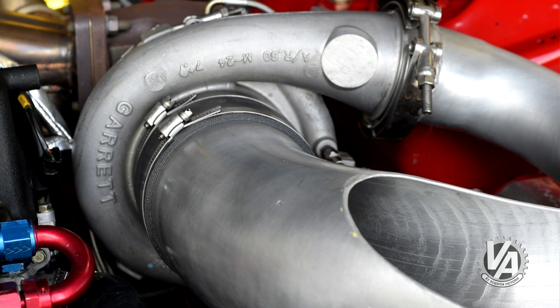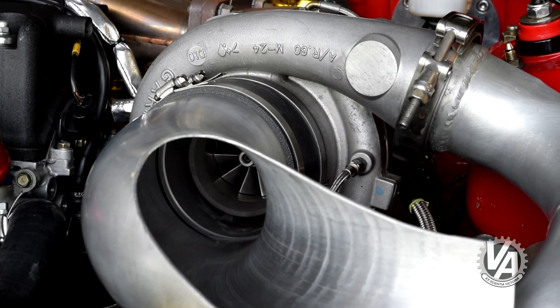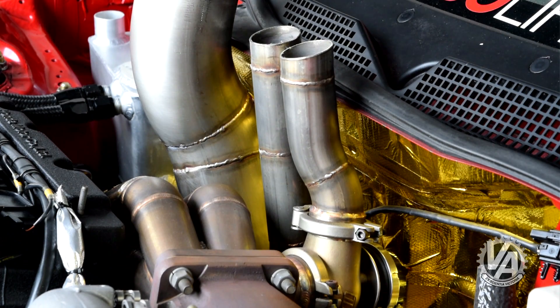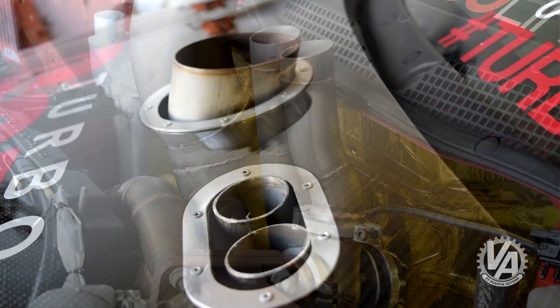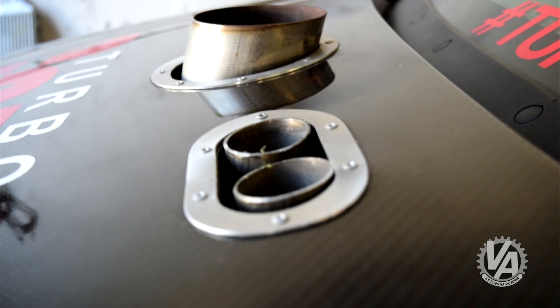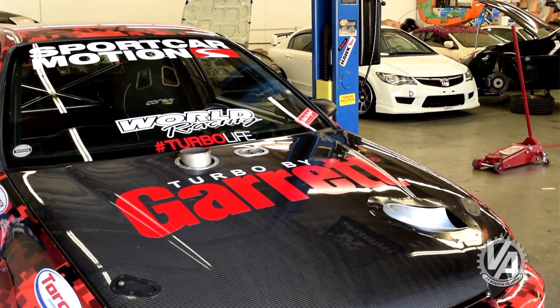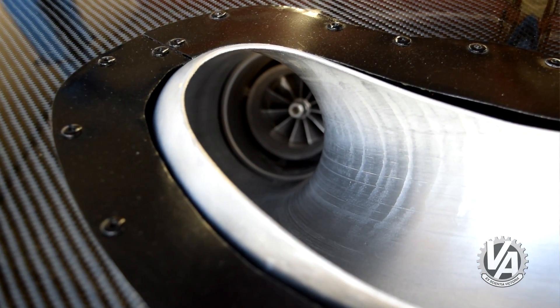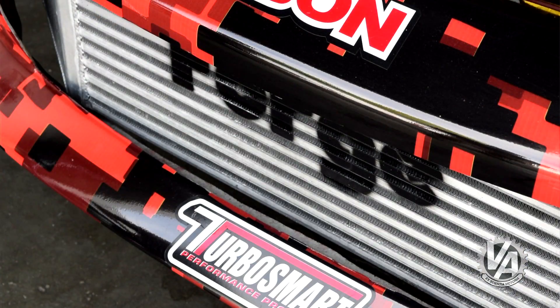For a thousand horsepower, the turbo kit is an AFI turbo kit — really nice stainless. It's a twin scroll style that feeds into this Garrett GTX4202 turbo. Because it's twin scroll, it has two wastegates, and they're both vented up to the hood along with the normal exhaust.